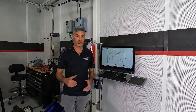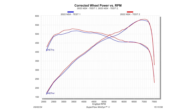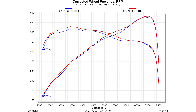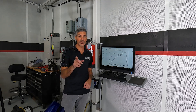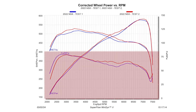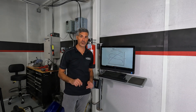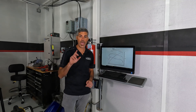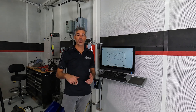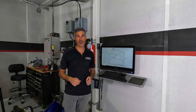Another reason why monitoring motor torque output is important is illustrated by this next graph. Here we have a test showing a nearly 15 horsepower gain in red. What did we do to the engine? Well, it turns out nothing. The only difference was motor torque output. In the red graph, we began testing at 75% battery state of charge, and in the blue graph it was 50%. The motor output is significantly affected by battery state of charge and battery temperature. You can view both of these parameters using a tool like the Autel under the powertrain module selection.